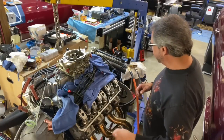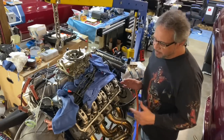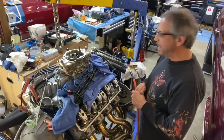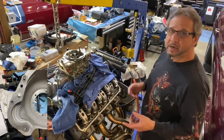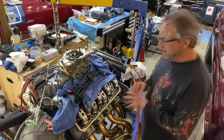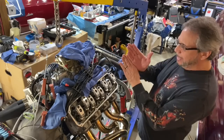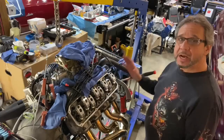One good thing about the mighty mount — once we figure out a couple of idiosyncrasies, Doug Smith mentioned a bell housing welded onto the arms of the engine hoist so it's more mobile and you won't have to unbolt the bell housing. I think I have a great plan for that, and also a better starter bracket because the current one is way off. I also went through and did all the valve lash, checked everything, and checked that the rockers are lined up with the valve tip and not off to the side — they're all perfect. That is key for high RPM.